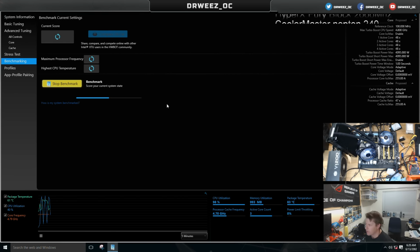Okay, so we're normally crashing around 3/4 of the way through. What I pumped up there was the memory voltage to 1.8, just as a Hail Mary to see if that makes a difference. I did put it up earlier to 1.75, and it didn't make a difference. Let's just have a look. It looks like that was the problem.